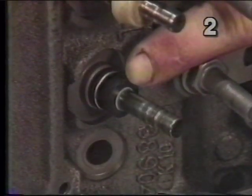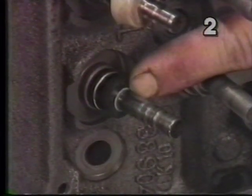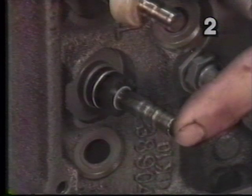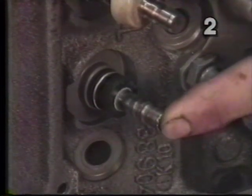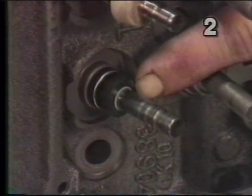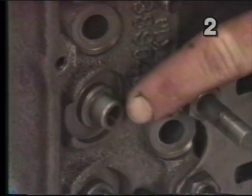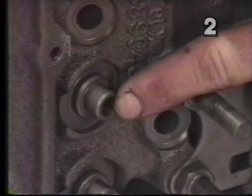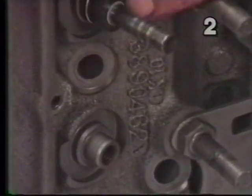Finally, let's look at the positive valve seal. This seal fits snugly onto the top of the valve guide and also snugly against the valve stem, therefore sealing the valve stem and the guide from oil. Also notice that the seal stays affixed to the head and does not move with the valve as the other two did — instead, the valve moves through the seal. This seal must be used when using a high-volume oil pump, because with a high-volume pump, the level of oil under the valve cover can rise to a point higher than the top of the valve guide. If this occurs, oil will be drawn between the valve stem and the guide and be burned inside the engine. The positive valve seal is the only way to ensure that this does not happen.